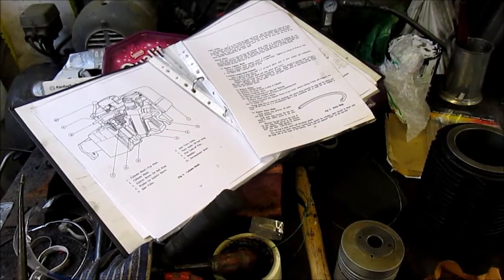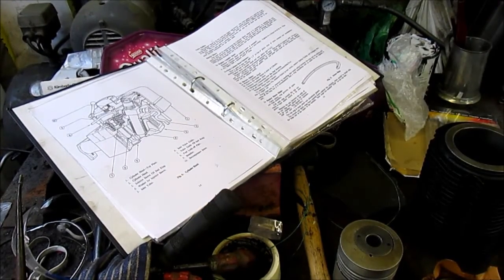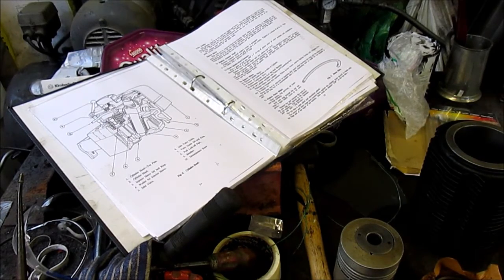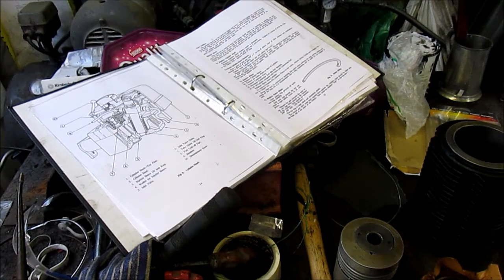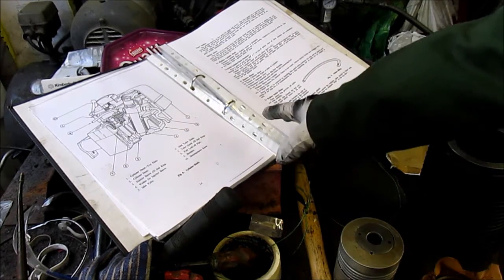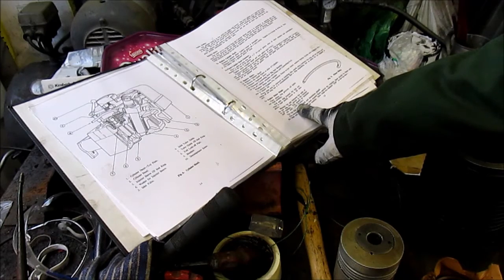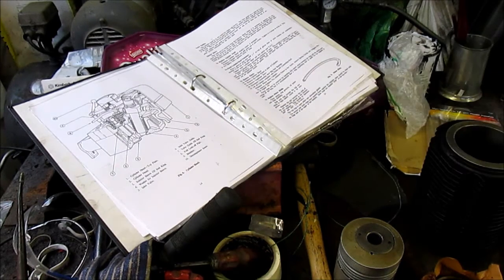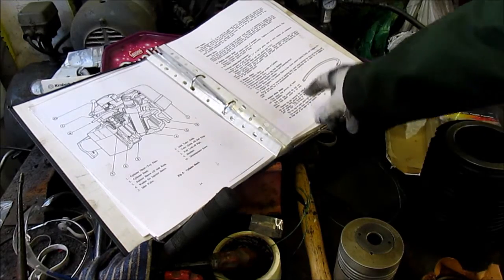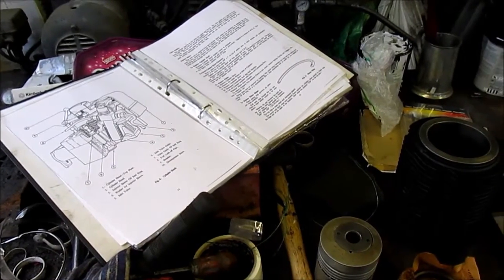The ring information is on page 15. The ring gap should be 8 to 20 thousandths of an inch, according to the manual. I think I'll go for about 9 thousandths to have a bit of slack - 8 is the minimum, 20 is the maximum. It doesn't mention oversized. For metric, that's 0.20 to 0.50 of a millimetre. I'll show you what to do, but the camera batteries are dying so I'll put new ones in quickly.